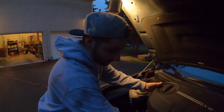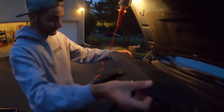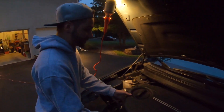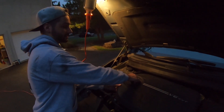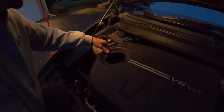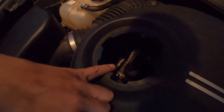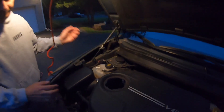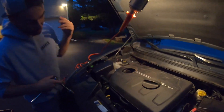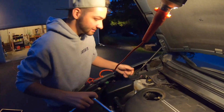Now we're going to do the oil change. I took this whole engine cover off just to access the air box easier — it's not necessary if you're just doing the oil change. The oil filter will be right there — that little canister. We'll start doing that now. We remove this little cover out of the way — it's a 15/16th if you're using American units.